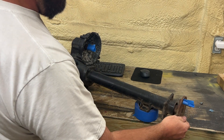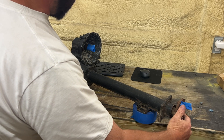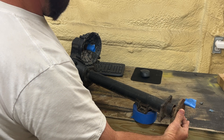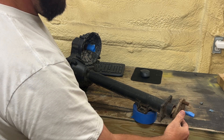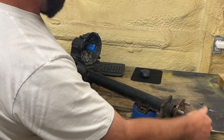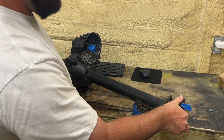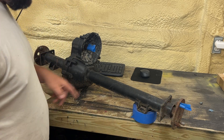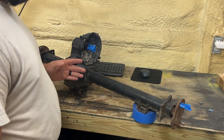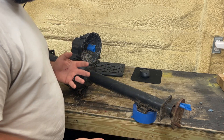We can turn the right wheel while I hold the left one. Turning the right wheel, the motor turns once, twice, three times, four times, five times, six times — and I'm right back at the top. Then we multiply that by two, so this is a 12-to-1 gear ratio rear end — this is the stock gear ratio.